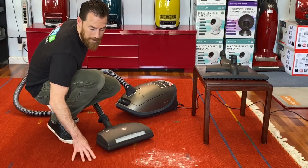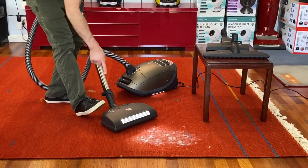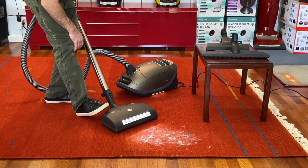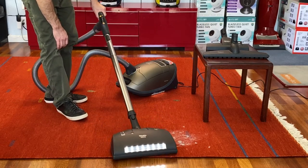I already know this is a low pile carpet at number two, but I'll show you now. I'm going to turn our suction on, turn our power head on — I'm on five, four, three — listen at two — it grabs the carpet. That's where you're going to get your best performance, when it just touches.